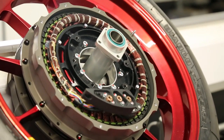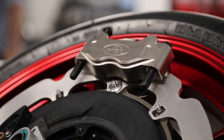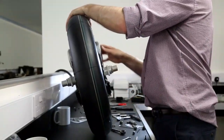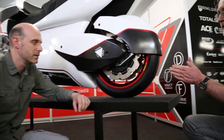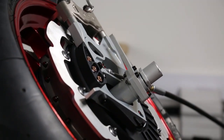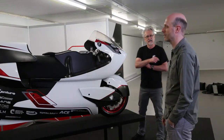We also have two electric motors within the hub. If you look at it from the front view, those electric motors are tucked within the brake discs, so we've had to go a little bigger on brake discs. Quite often you'd have brake discs spaced out, but the whole bike is optimized so you're within almost the tire profile. There's a lot going on in the front wheel — it's a bespoke front wheel but we managed to package all of the motors within it.